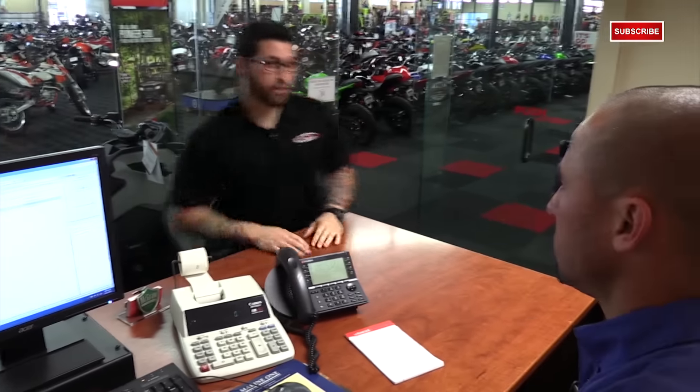Hey Andy, what's going on? Hey Matt, how are you? Doing alright. So you have a set of these tires on your 2014 Can-Am Maverick Max. So can you give us a little bit of insight on why you chose those tires over anything else? It seems to be one of the more popular tires we're selling at Chap. I have the stock rims and tires that came with the car. I was having some issues on some different terrains and decided to try these. I went to 28x10x14s, running about 10 pounds of air, and it seems to fit my car very well on all the different terrains we run on — they're holding up well. So how are they wearing for you? I have about 500 miles on them and they look as good as the day I bought them. So would you say you had an overall great experience? Yeah, the tires handle great — they handle any terrain I've been able to conquer, they're wearing good, and they handle nice.